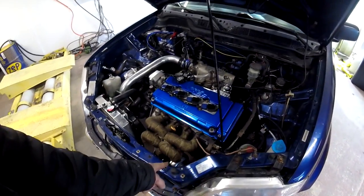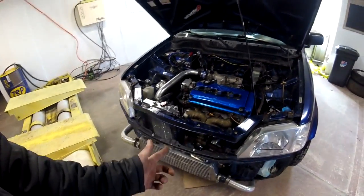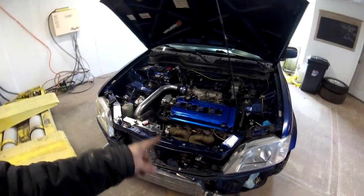So like I said, this is a GSR motor with a VS Racing 3076 size turbo. It's got a ram horn manifold and a Tial wastegate. I think this setup was actually on the brown Integra that I did on the channel here, and this guy bought the turbo kit from him.